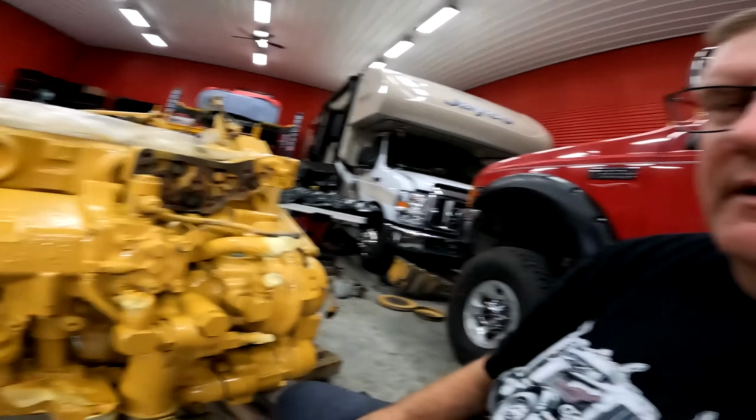And yeah, when I put it back on, I noticed there's some rubbed spots. And this one, the wire is actually rubbed. You can see it right there. So I'm gonna have to fix that. Part of me thinks I should take this sending unit off the other manifold right there. But the other part of me is like, you know what? Just fix the wire. You know, I'll use some heat shrink, maybe solder it so it's good. And then I still have a spare. And that's the beauty, is having all these spare parts.